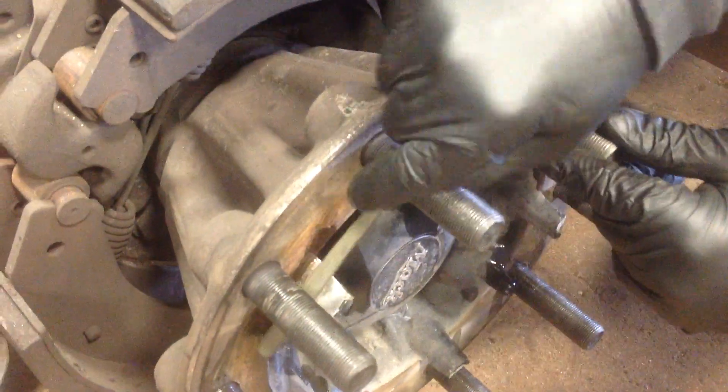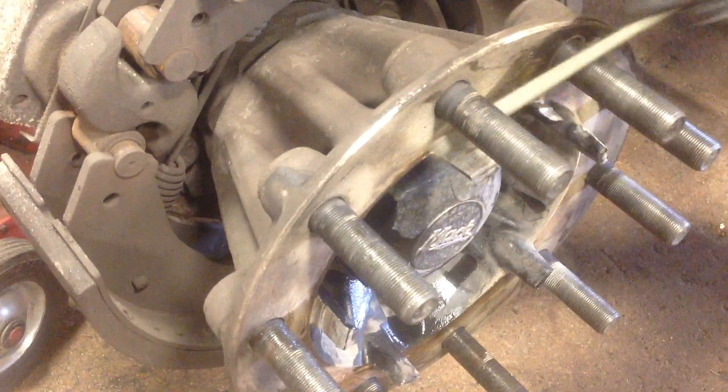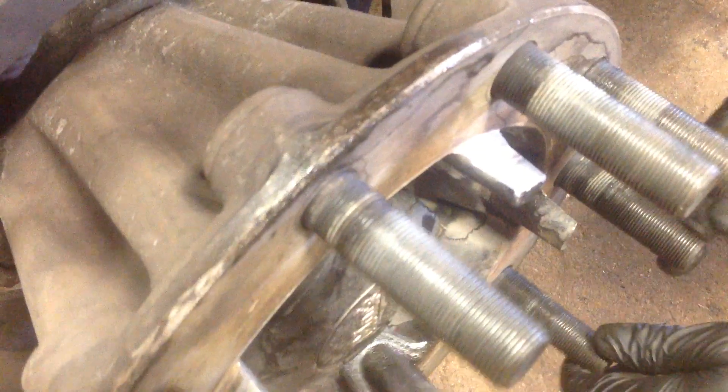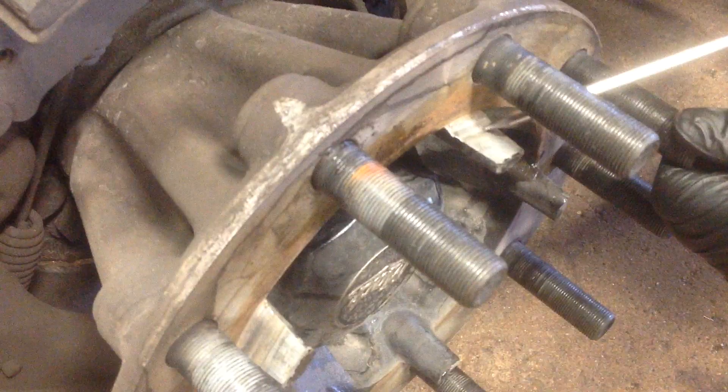As you can see, Mark, what we really need to do is inspect the pilot area for the brake drum. On this particular truck, what we noticed is two of the pilot areas that centered this drum are gone. As you can see — that one there — is that a good one? No, that's a bad one.